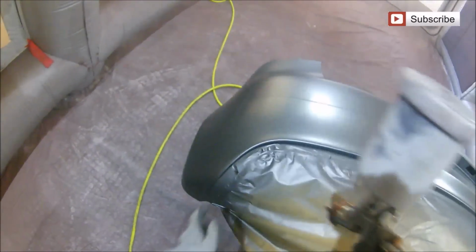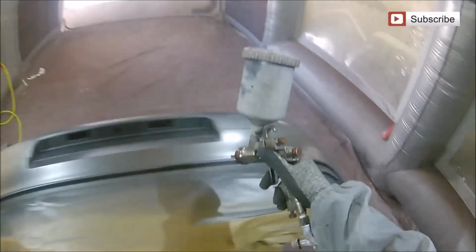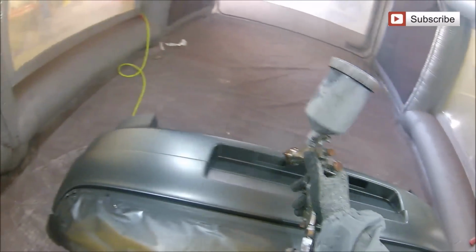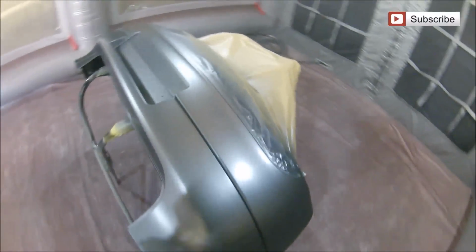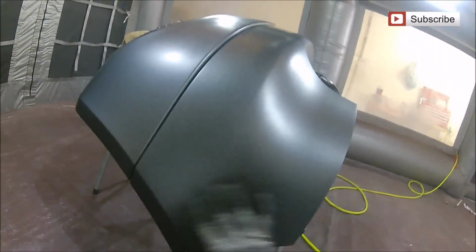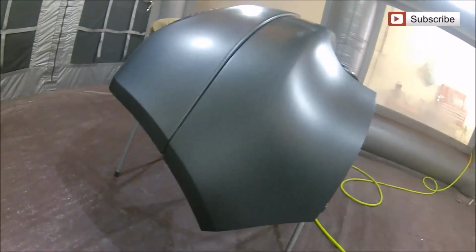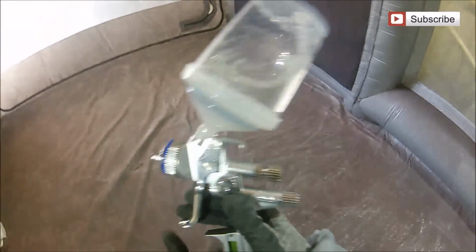Through this bit that we've obviously taken away from being a factory rough plastic finish to being now a nice smooth factory looking painted bumper, and it's still got its little original bit at the bottom in black where the exhaust and stuff come out, but this now gives a lot of a cleaner look, and you can see there we've got a nice even colour. I can't see any differential where the blends or anything are. And when you look at this corner now, basically that is the edge that you want to keep your paint off. When you're putting the paint down, you want to make sure that your overspray and your blending goes a little bit higher around that area so that you don't touch those areas where it touches the car.